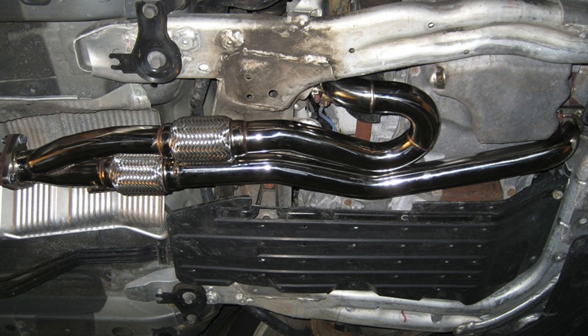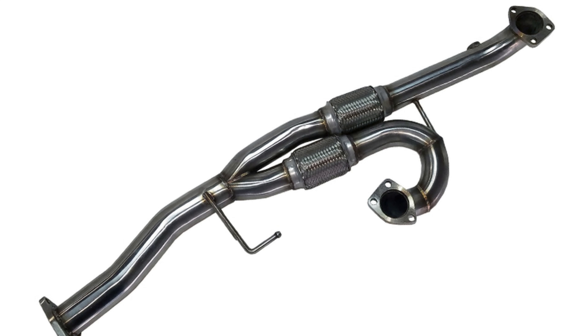With the J35, like other JDM V6 transverse-mounted engines, there's the J-pipe — the pipe that connects each bank of the motor into one — and replacing this can really give you a big performance boost. A lot of aftermarket J-pipes move the merging point much further back on the vehicle, whereas the OEM pipe merges as soon as possible. With a full bolt-on setup you could easily see your J35 get up into the 320 to 330 horsepower range, which is actually pretty good for a 3.5-liter V6. Sure, it's not a B-series or K-series in terms of horsepower per liter, but it's still a decent amount of power and it's also making a decent amount of low-end torque, whereas those four-cylinders really rely on high rpm rather than high torque.